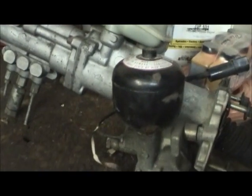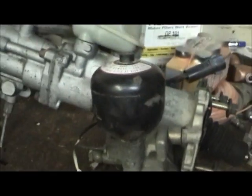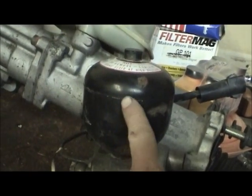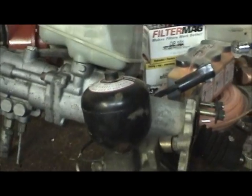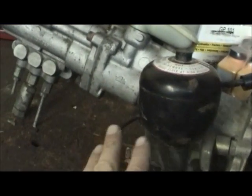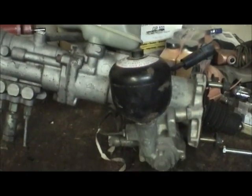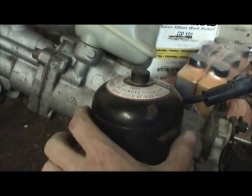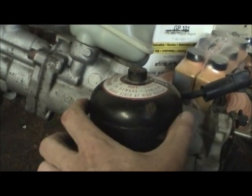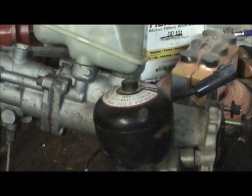The second clue is if you have your brake light come on continuously every time you actuate the brake pedal — that's usually a telltale sign that the accumulator is not allowing enough pressure to build up. The pump runs, charges up a little bit, and when the pump turns off, it just comes right back out again, and you end up with a slightly hard pedal. It's not really ever able to reach the design value of 3,000 pounds. Accumulators are most often what fail because it's a moving part. You have a diaphragm in there, and over time it just gets hard and cracked and the gas leaks out, becoming less and less effective over the years.